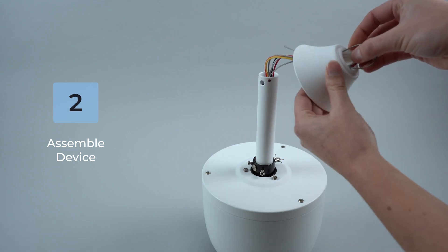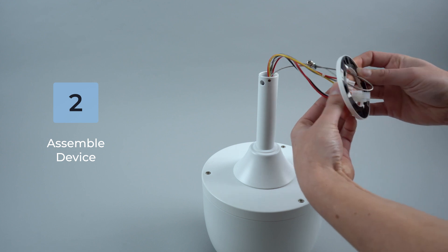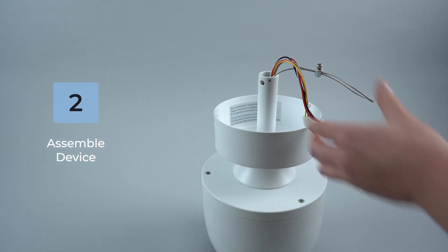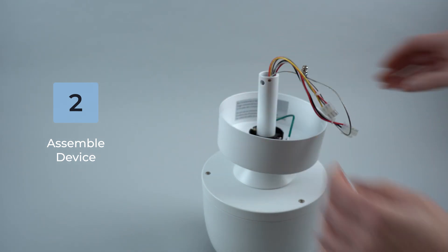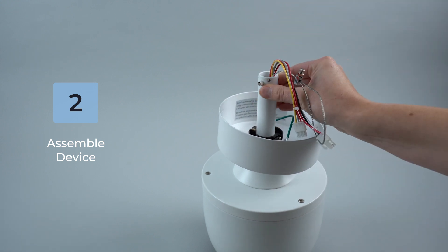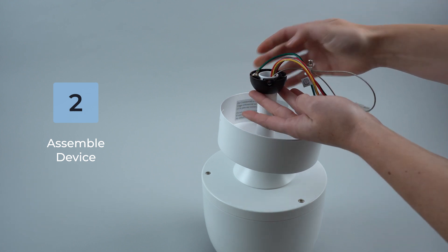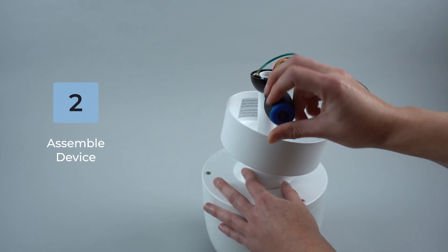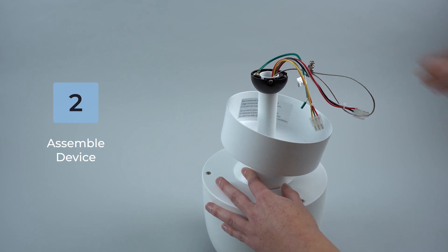Secure by reinstalling with the locking pin and tighten all the screws until you feel resistance. Next, slide the decorative cover onto the downrod, then add the canopy covering — ensure it is facing upwards. Finally, add the canopy. Slide the hanger ball back onto the downrod and reinsert the cross pin into the large hole. Raise the hanger ball up and nest the cross pin in its groove, ensuring all screw holes align. Reinstall the longer hanger ball screw, then tighten both the long and short screw until the hanger ball is properly secured.